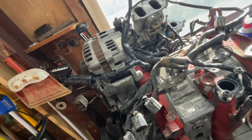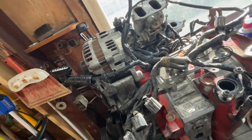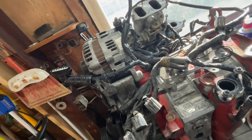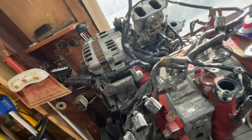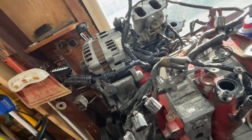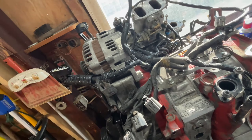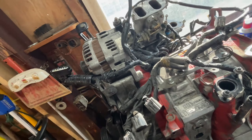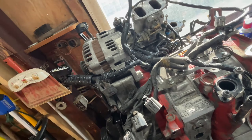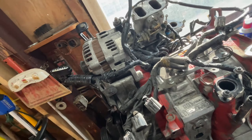I think there's a fuel line probably currently still in the engine bay that's supposed to go underneath and hook up to the rail — it's going to be a little difficult to reach once I have all of this together in there. I also need to track down some vacuum lines because there's supposed to be three of them here. I don't have extras laying around. Could this be used as a vacuum line? I don't know — is this supposed to go in here? It's going to be kind of almost impossible to do anything with when I have all that stuff on, so I'm gonna go ahead and put the gaskets on the Y-piece and put the Y-piece on here.